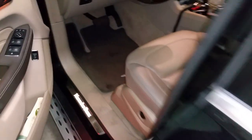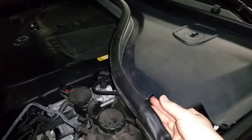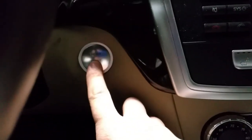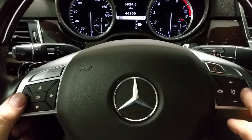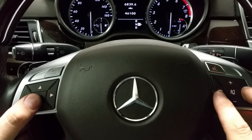Open your hood and on the driver's side you will need to open the brake reservoir cap. Without pressing the brake, press your start button, then press the selector button to your left until the trip highlights. Hold the accept and down button for two seconds and press OK until the menu shows. Let's go ahead and do it.